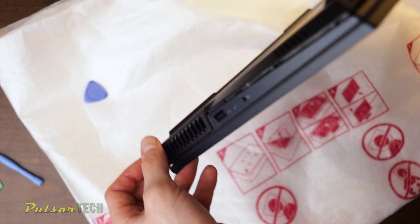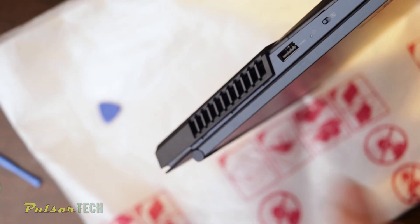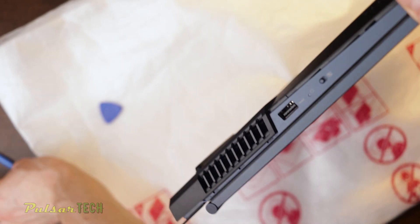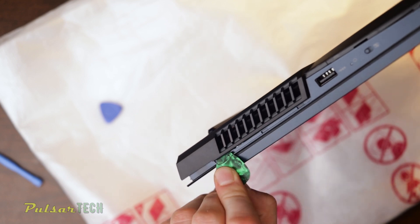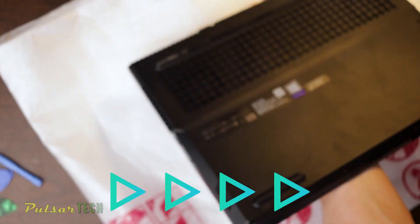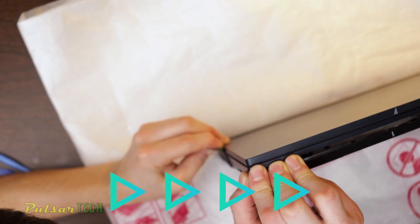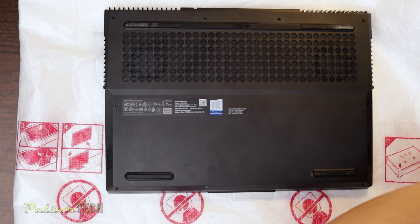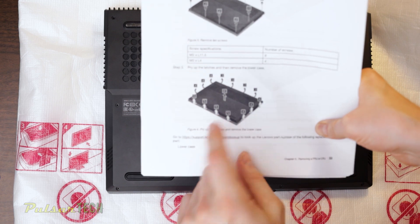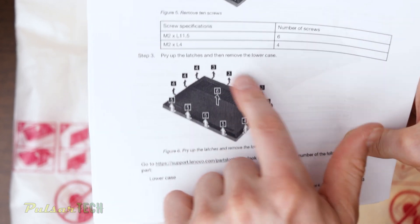As you can see, I've got it almost pried up and almost all the latches are released, but the most difficult part is where the side vents for the fans are — there are three latches there and they're pretty tough to release. So you've got to be patient and careful not to break them. I prefer using the thin guitar pick for this because it's much thinner than the pry bar tool and works very well. Once all the clips and latches are released from the sides, front, and back, there is also one latch in the middle, so just pull it up until you hear that click and the bottom cover will come off.